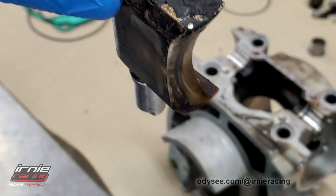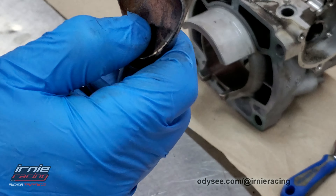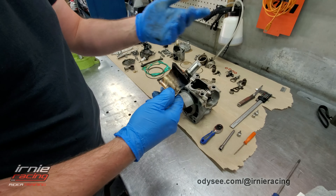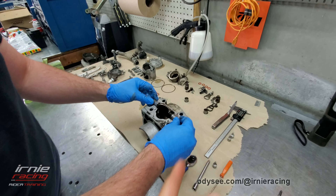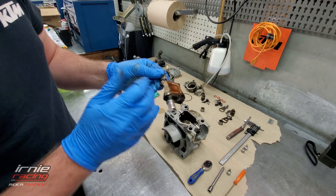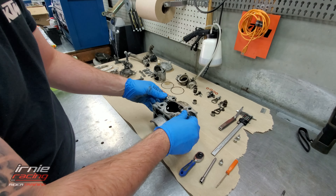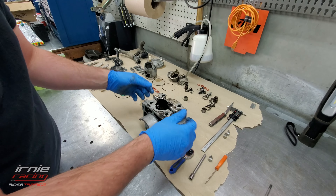It's very important to try to keep it clean in the first place. If we leave it, it will obviously continue to build and then you'll have problems. Even the Amsoil or cleaner is just not able to get it all out - because this is behind the whole power valve. By spraying it down the cylinder while it's running, it's just not getting in there on the sides. You've got to pull the power valve and clean it.